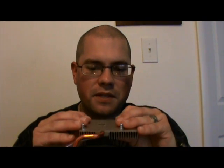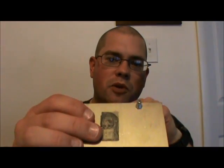So, without further ado, I'm going to get right along with it. The reason why we need to replace the thermal paste on the Xbox 360s is because Microsoft manufactured these guys, because the Xbox One is now out, just using this cheapo thermal tape. Now thermal tape, if you're in a hurry, it'll work. It'll do the job. But honestly, really, truly, if you actually care about what you're doing, use thermal paste.